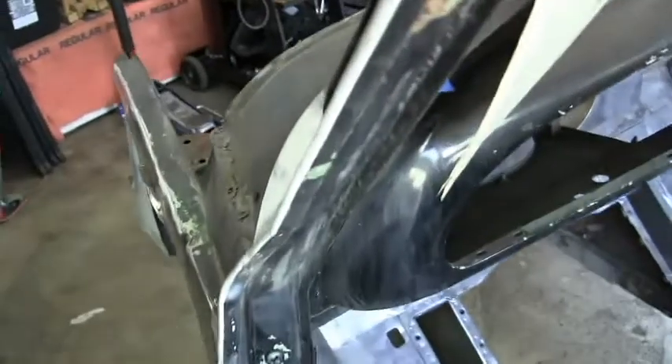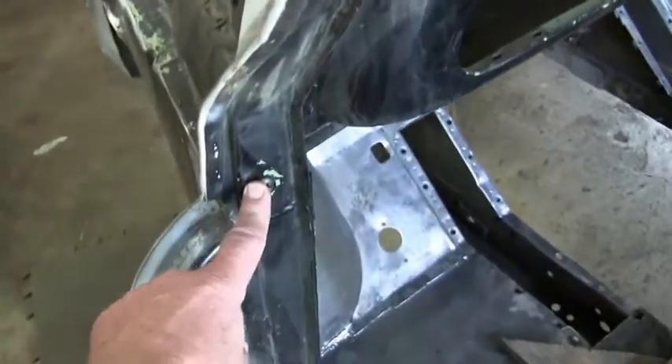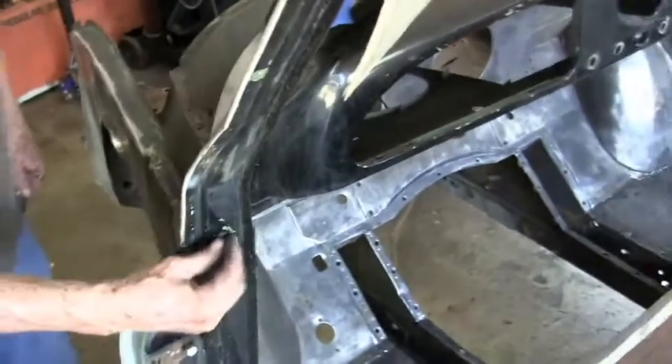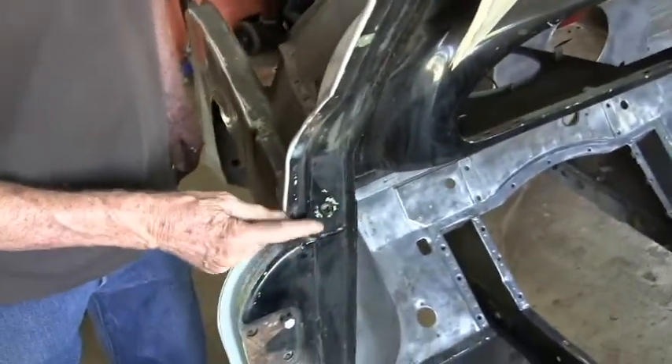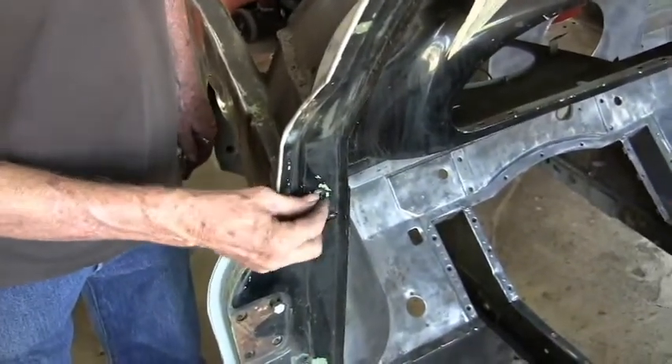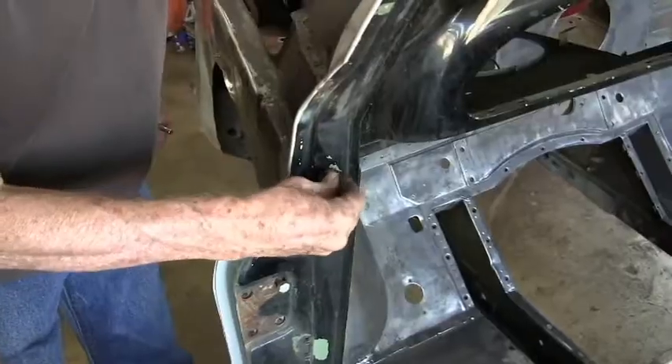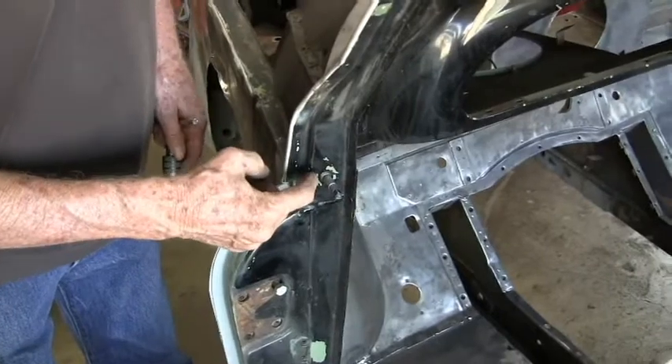So what we're trying to do is remove these little door light courtesy switches, which are completely defunct. The spring inside has rotted away — goodness knows how long ago. See, it's got that little plunger that sticks out. Replacement ones are pretty cheap as long as you can get the old one out. Those four little prongs fit down in that switch.